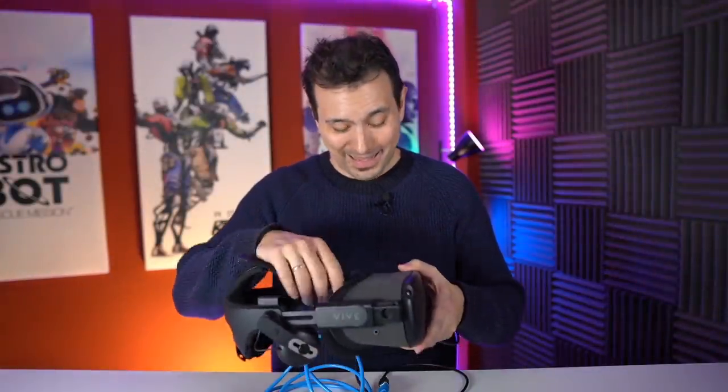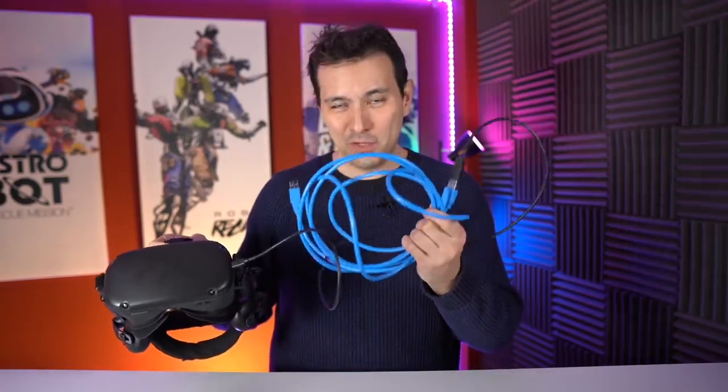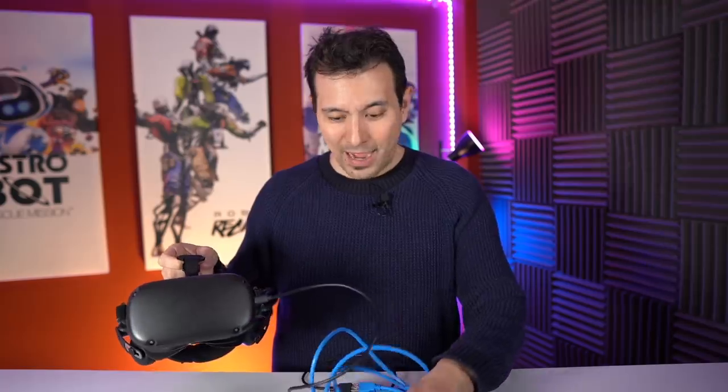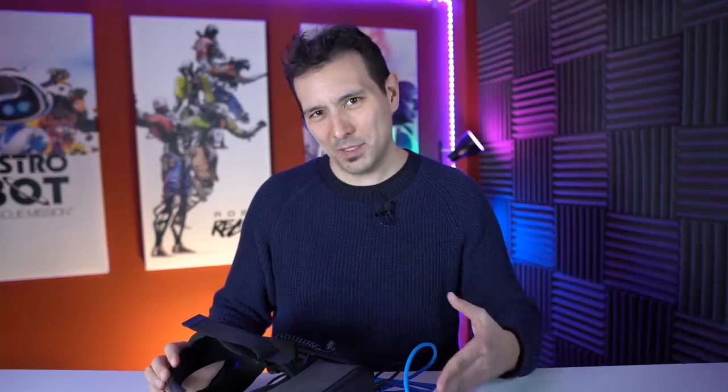I'm really happy. It did work with this one-meter cable and the three-meter cable extension. Both cables are at least USB 3.0, so that's really important — you cannot just use any USB 2.0 extension, it will not work. I tried it on all my ports and on most ports it didn't work, but on one port it did. I'm using a PCI Express card — the Inatec five-port USB 3.0 card. I'm going to link this PCI card on Amazon in the description below, as this one does work.